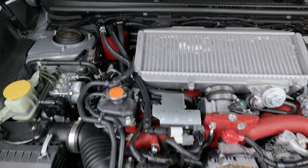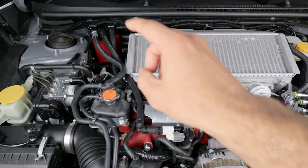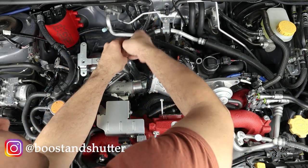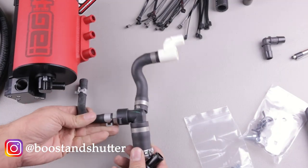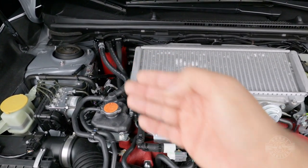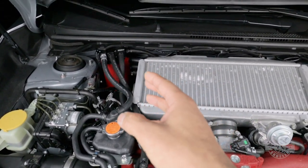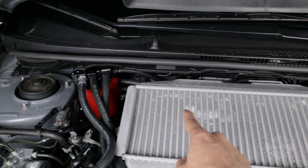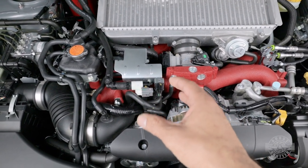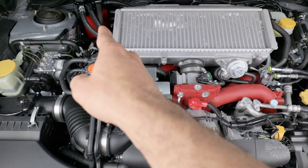The third important outlet is the top hose, which has the PCV valve from the AOS kit installed in-line, routing underneath the intercooler to the intake manifold — because as part of the installation we removed the entire stock PCV assembly and replaced it with the air oil separator. Now you know where the AOS gets its gases from and where it puts them back. The main purpose is to swirl those gases, separate out the oil, and the drain port on the bottom runs underneath the intercooler to the center port on the block via a Y-splitter — one end feeds gases in, and the other accepts the separated oil returning to the engine.